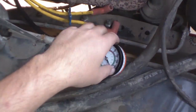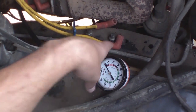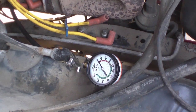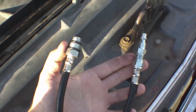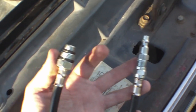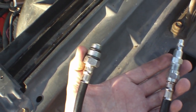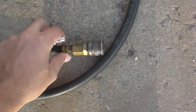I'm going to disconnect my compression gauge and attach a tool that lets me put some air pressure into the cylinder itself — I'm going to do what's called a leak down test. Here are the parts: they're very similar to the hose portion of the compression tester but with a different fitting on this end so I can hook it up to my airline.